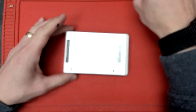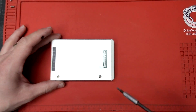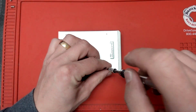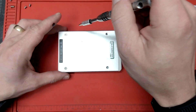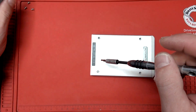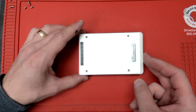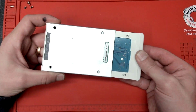On the bottom you're gonna have four screws. By the way, this was already fixed by Seagate for the same problem. We're gonna remove these four screws. A piece of advice: for people who have this type of drive or any kind of external drive, do not carry the drive with the cable plugged in — that's one of the main reasons why connectors get broken.